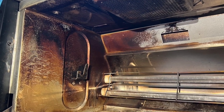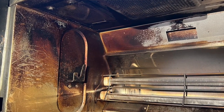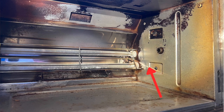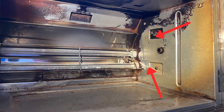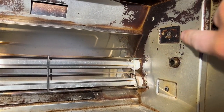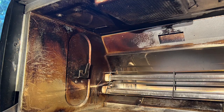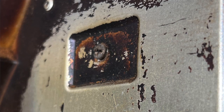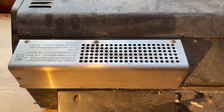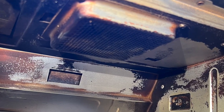It looks like there was a chaff fire in here at some point, if not multiple. One spot in particular I want to point out is right here — that's where your thermistor sensor is located, and that is used to regulate the temperature of the heating elements. When this gets dirty it's not able to do its job. I'm going to try to clean up the inside of this roaster as best I can, pull the side panels and the back panel as well.